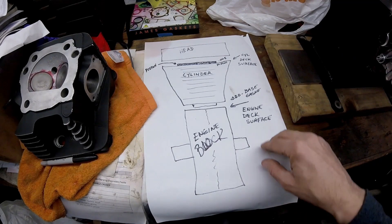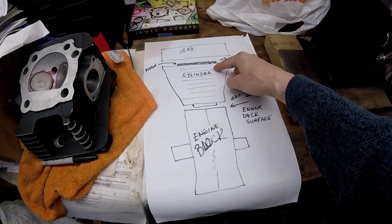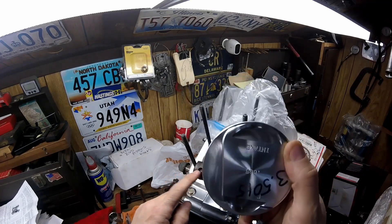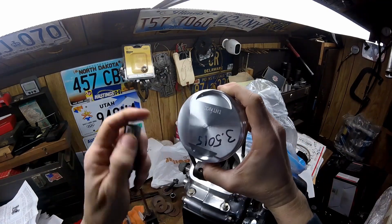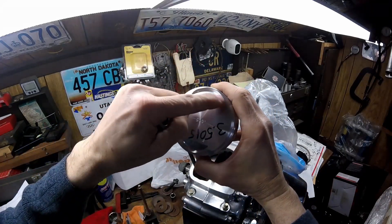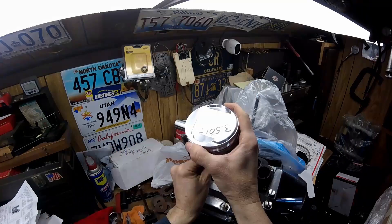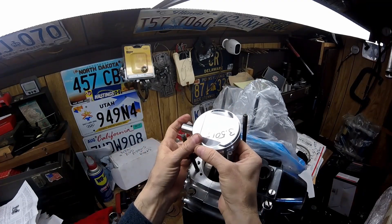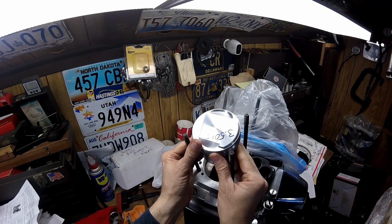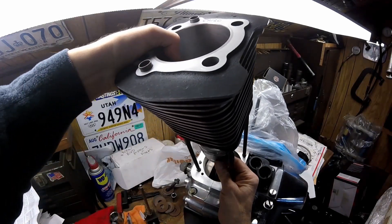James makes all different thickness base gaskets, so I'll mix and match gaskets to get the squish where I want it. The kit has 45 thousandths thick head gaskets that I won't be using. Now the next part is to figure out whether your piston is sticking up or sitting down in the cylinder. I take the piston, put it on the rod with the wrist pin, orient the intake towards the intake manifold — that's always the bigger valve side. Start the wrist pin in, bring it onto the rod, slide it through, and the cylinder goes on without rings needed for this check.